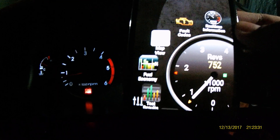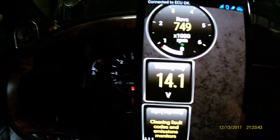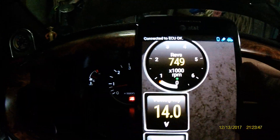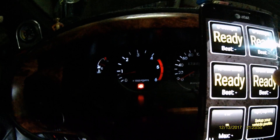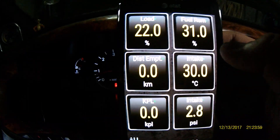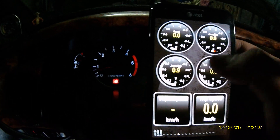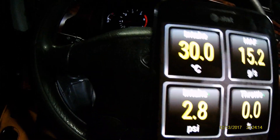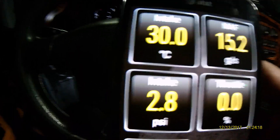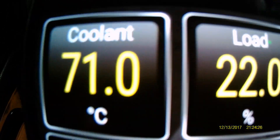It's a bit slow but it will sync up since I just recently selected that protocol. A while ago it wasn't responding, but right now it just told me the car has already reached its operating temperature. Let's go to the main application and check the other information that wasn't showing before. The intake is now showing 30 degrees Celsius, the MAF (mass airflow) is showing 15.2, intake is 2.8 PSI, and the coolant now reads 71 degrees Celsius.